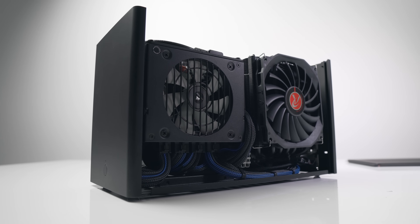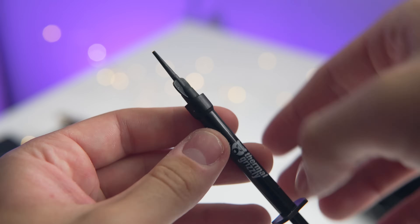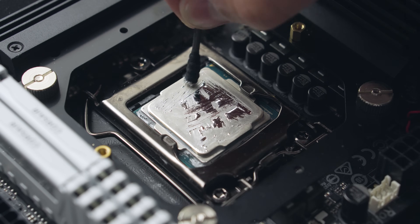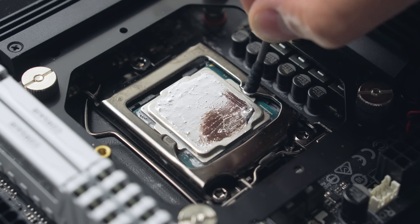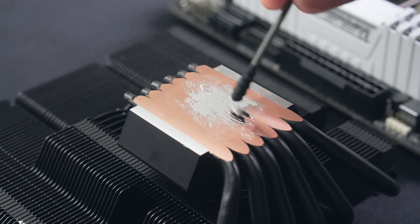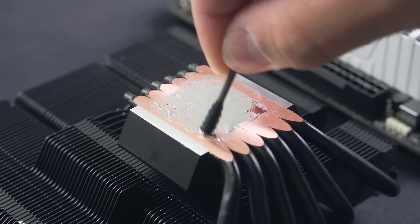Now that we have our baseline result, let's go ahead and apply some liquid metal. I'm using Thermal Grizzly Conductonaut here, as I've had great results with it in the past and have seen no problems even after several months of use. I'm applying a pinhead amount of liquid metal onto the CPU's heat spreader, then taking a few minutes to spread it out evenly over the surface — making sure it doesn't spill or contact anything else, as this stuff is very messy and electrically conductive. Do the same for the bottom of the CPU cooler, and make sure it's not an aluminium cold plate, otherwise there will be a chemical reaction. Thankfully the Palace 120 is copper, and every Noctua cold plate I've encountered is nickel-plated copper, so they'll both be fine.